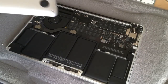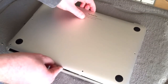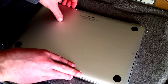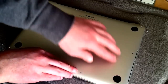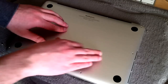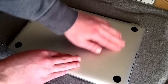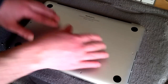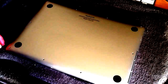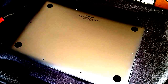And so that's all that really there is to it to dusting out your computer. Then what you'll do is put the lid back on. Take your time with this — don't rush it, because if you rush it, you might break something. So it's lined up, and then what you can do is just press down until the clips click. You can hear those two clicks — that means the cover's on, it's good to go. Then we're going to take our screws, screw them back into place with our pentalobe screwdriver, and then that's that.